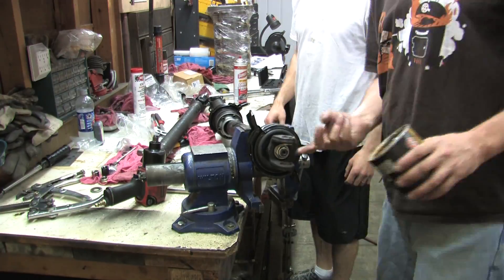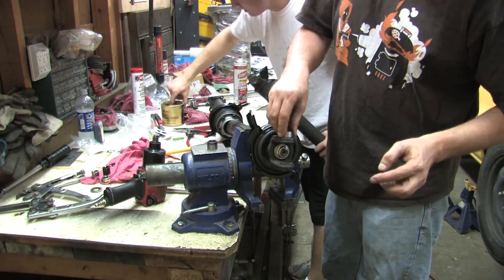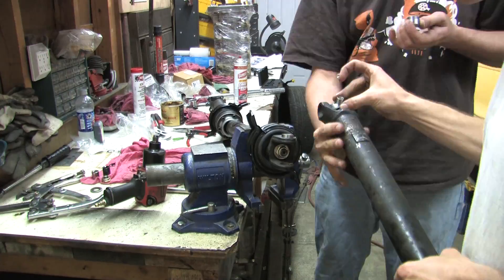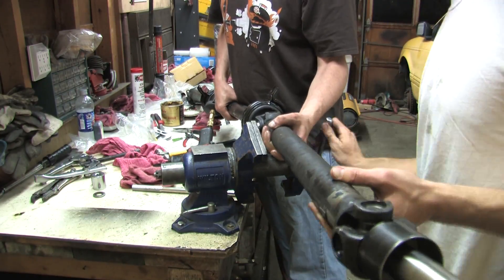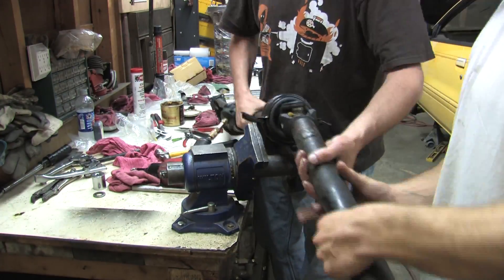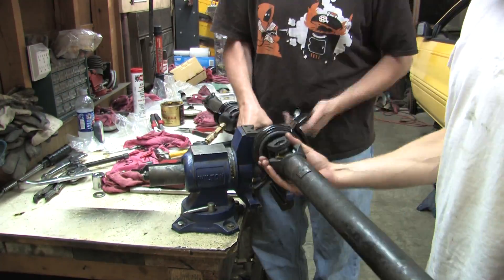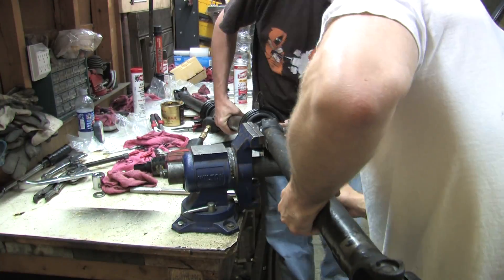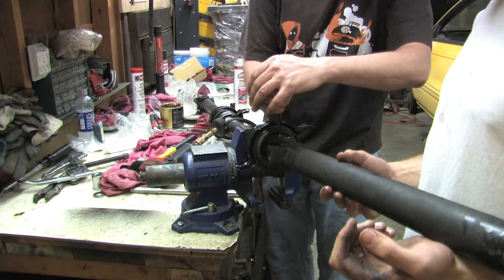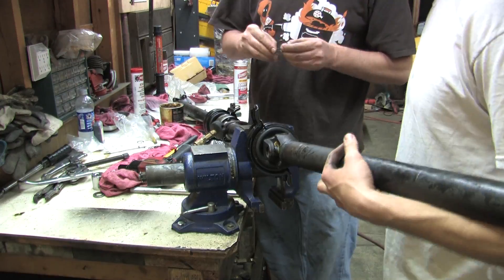We got smart this time and greased the cap bores to make compressing with the vise a little less like work. The reason we saved the second half of the B-joint for last is because it gives us an opportunity to get a feel for the A and D joints first. The center of the shaft offers too much leverage to feel it out without the 12 ten-thousandths feeler gauge that we don't have, so we based this last set on how easy it is to install the snap rings. It's an acceptable method, but certainly not as scientific. As long as the tension feels even on both axes, you're good to go.